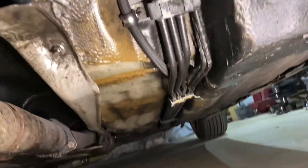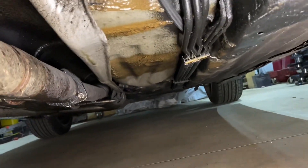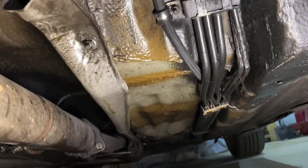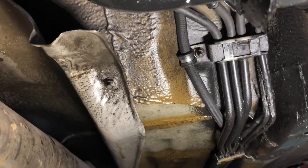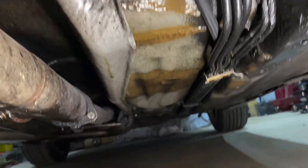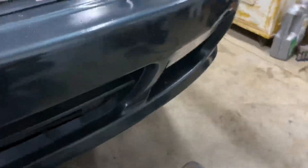Underneath the car you can see I have my stock fuel lines and also my PTFE lines, which I basically just tuck underneath the stock fuel lines — it holds them nice and tight. I did use some straps to hold that one tight to the firewall, and it runs the whole way back to where the tank is. On a fifth-gen Prelude there is a plastic tank guard that can just be unbolted, and you can slip the PTFE line up over the top of the tank.